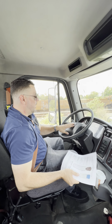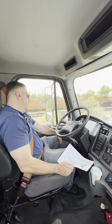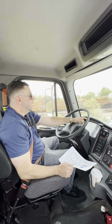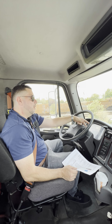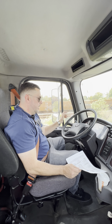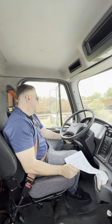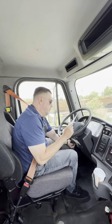For horns: my electrical horn is working. For the air horn, make sure the air pressure is above 60 — if not, it won't operate. Make sure the air pressure is full and then sound it. If the truck doesn't have an air horn, tell the examiner this truck doesn't provide an air horn. In this case it doesn't have one. Whether it's a rope or a little button, mention the electrical horn and check the air horn as well.